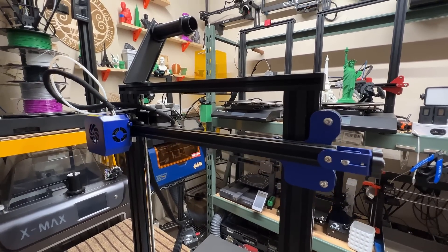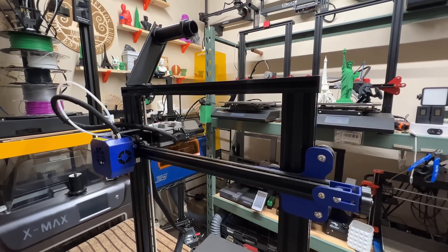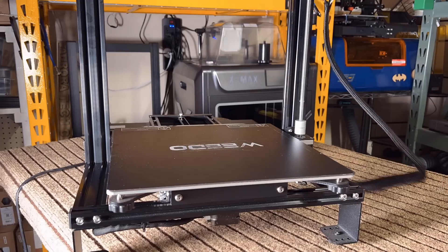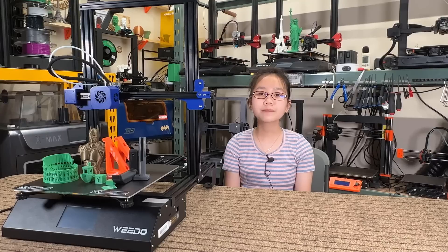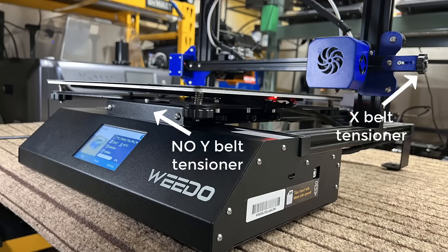The Z-axis limit switch is installed at the top. When you home the printer, moving the gantry to the top can synchronize both sides of the gantry. I think this is a pro, but the trade-off is you have to wait for it to go up and then come down. As this printer is still not in large batch production, I would highly suggest they adjust the following cons and make some improvements for their final product. First, there is a single Z-axis — as a new generation printer in 2022, especially at this print volume, I would like to see a more stable gantry controlled by a dual Z-axis. The Z-axis and the extruder did not come with a silent stepper driver, so it still makes noise when the Z-axis moves or when the extruder is extruding filament. There is no Y-axis belt tensioner — after months of printing you may need to adjust the belt tension, so adding a Y-axis belt tensioner is necessary.